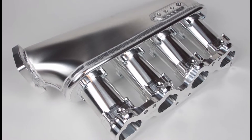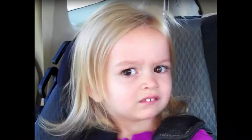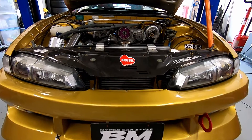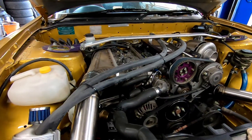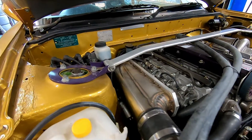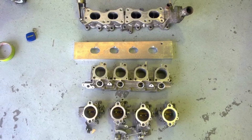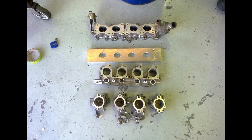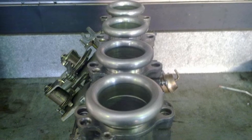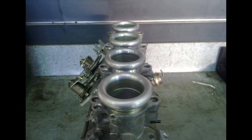Imagine you just had an awesome intake manifold made, but come time to fit it you realize that it doesn't fit because you didn't take into account the brake booster clearance. This is exactly the predicament I found myself in when I changed to individual throttle bodies on Gene 13. I'm running a custom DC fab plenum mated to 4AGE silver top throttles on a modified 4AGE inlet manifold with a custom adapter plate mated to the CA18 lower intake manifold. This long runner design ensured I didn't lose any low down torque, but the downside was a very large package.